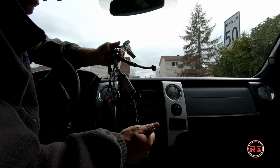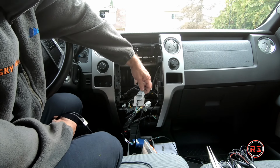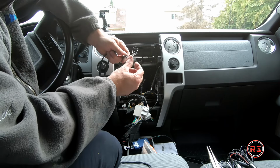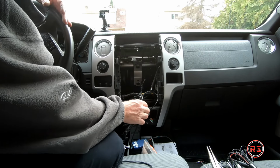adapter. So those gray connections, we already know that it's connecting to the factory connection of the truck. Connect them before I lose anything. Here. Finally, I removed those, because since I don't have the rear seat entertainment in the original harness, the holes were blocked and I could not push the connection into the harness because the pins were obviously not getting in since there was no hole. So I removed them. Now the connector fits fine.